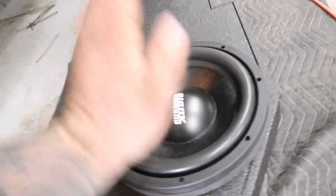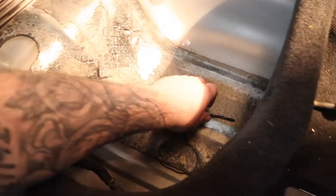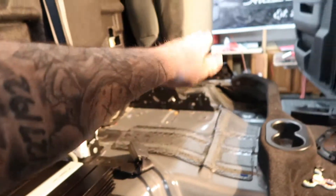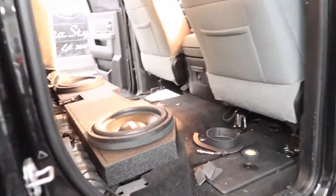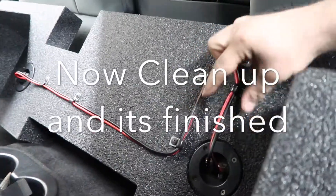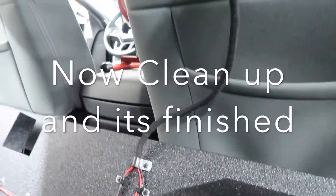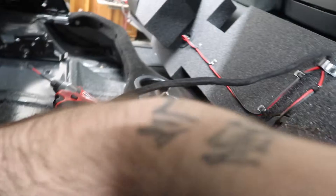We have the sub box here — two 12-inch E-series — and a prefabricated box just for this truck to fit in here. It's lined to match his bed. I did take the carpeting out because it has all that pad on the bottom; I just want to make sure it fits as tight as possible and doesn't hit the bottom of those seats. I ran the wire this way so it gets slack and would never get yanked out, ran across and doubled them up, ran some test tape — looks real clean. After it's laying down, he'll be able to lean those seats forward.